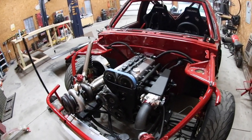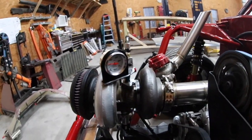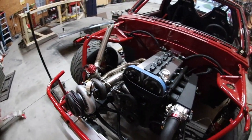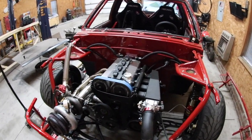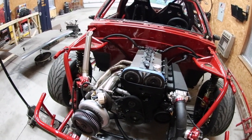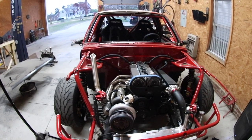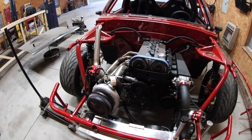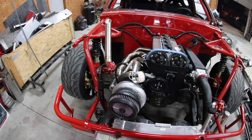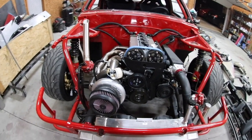All right, so we're fired up now — cold start is about 1200 to 1400 RPM. It's not tuned yet, so I don't know how much that's gonna change, but we're looking at a whole lot lower pressure here. At about 22 PSI. I'm gonna let it get hot for a little bit and see how much it drops. That is a significant change. Like I said before, we were at 75 to 85-ish PSI in the same exact scenario. So with that restrictor in, we're seeing quite a drop. Okay, I'm actually gonna drive it around, do a few cruises around the block. Fully warmed up, 750 to 800 RPM idle, I'm looking at about 5 to 8 PSI. We're shooting for 10, so I gotta take it back apart, drill it out, put it back in, and see where I'm at. I'll just keep doing that until I get my desired pressures.